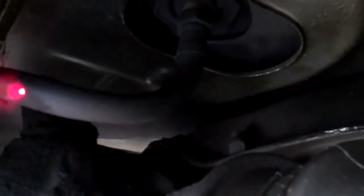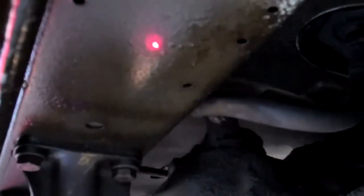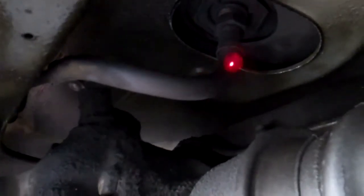The next thing I want to show you is the fuel tank hose. The fuel tank hose is wet and it's leaking fuel all over the back of the car. This is the fuel tank hose right here, plugged directly underneath the fuel tank, and all this fuel is leaking in the area right before the trunk spare tire. The trunk spare tire area is wet as well. The rear sway bar is all wet from this one fuel hose leaking, so I recommend changing the fuel tank hose.